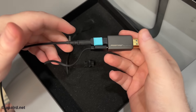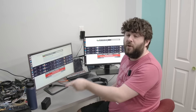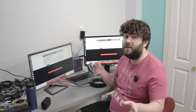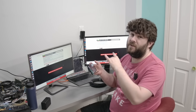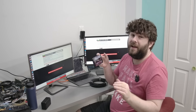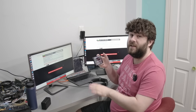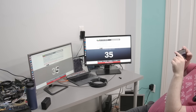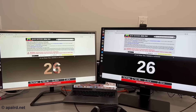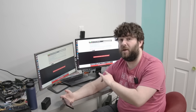With literally no effort, the two monitors came up. I've set them to mirror on my Linux system, both coming from HDMI outputs on my mini PC. For the latency test, the screen flickers every single frame between black and white with a frame counter — don't watch if you're photosensitive. Using a high-speed camera on both monitors, I can compare frame numbers. Watching back on my phone, they are perfectly in sync — there is no measurable frame delay difference between the plain HDMI cable and this fiber cable.